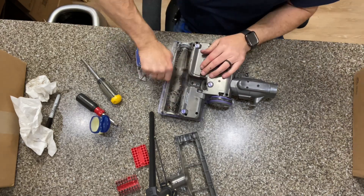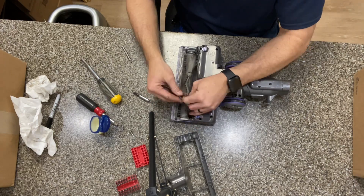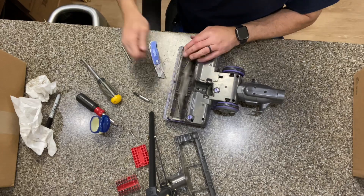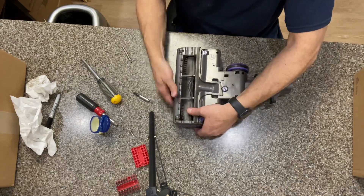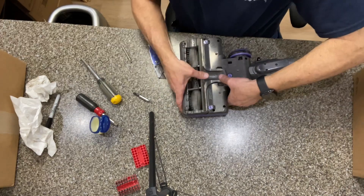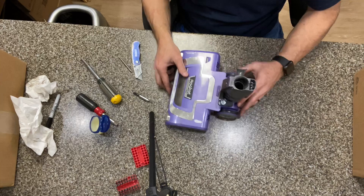There's the T10 security bit — that's the small one, and it's the only one that's different. I took the time to clean out the roller and get the stuff that gets wound on it while I had the casing off. Get your flathead screwdriver and you're ready to go. I hope this has helped y'all — you should be ready to go at that point. Thanks for watching.